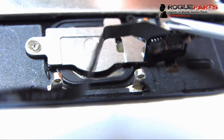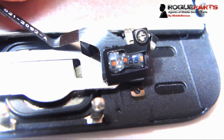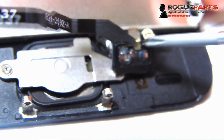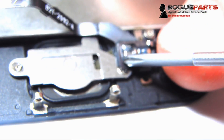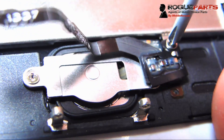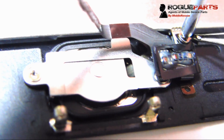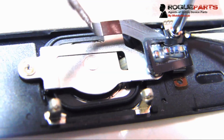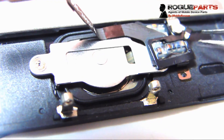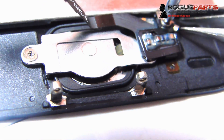We're going to fold this cable back over with the screw that's still in it — that screw should still be there. We're going to fold that thing over and plug it back in and screw it back in where it goes on the frame, on that metal shield. Mind you, we have put the frame back on — we did a screen replacement on this one. That frame should always stay on. This is important: that little connector needs to be pointed to the right. That connector will stay on the flex cable as you take it off with that screw. We want to make sure that thing is all the way to the right. Right now we have it kind of incorrectly placed, so we're going to loosen it a little bit and move that thing.